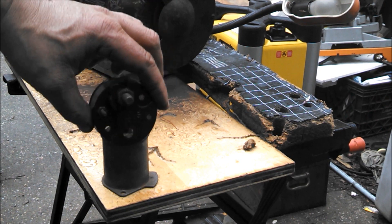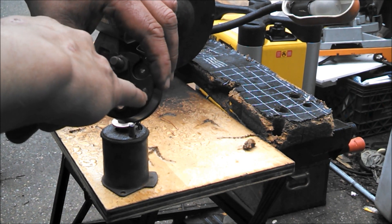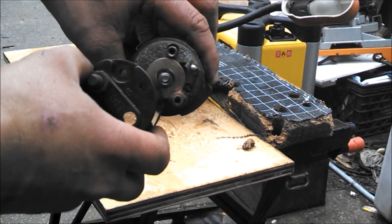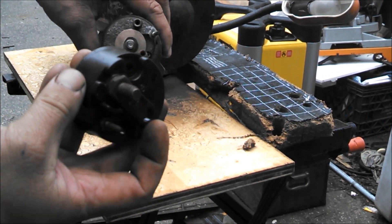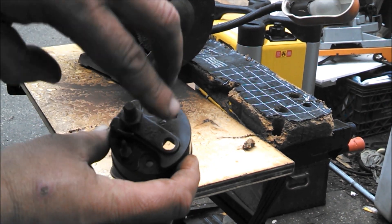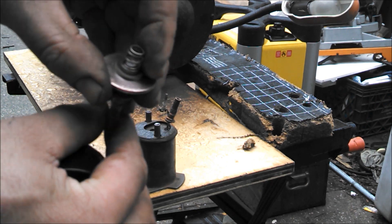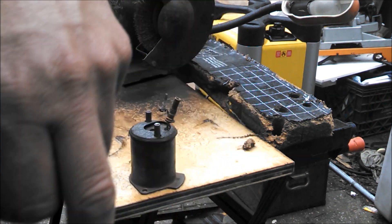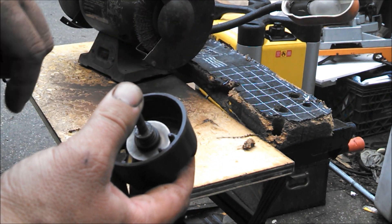One thing I wanted to add — when you take the solenoid apart, you don't have to remove the battery terminal and the R terminal. Just the start terminal, the S, and the one that goes down to the motor itself. You have to remove those because when you take this apart they sort of pull right out of the back. So just take those two terminals off, the nuts off that holds it down. I wire wheeled this all up. I cleaned up this contact — that's the contact I mentioned. When this stud is in place and that button gets pressed down, it closes this contact, the connection across those two studs. Makes the contact, sends the power down to the motor, lets the motor spin.